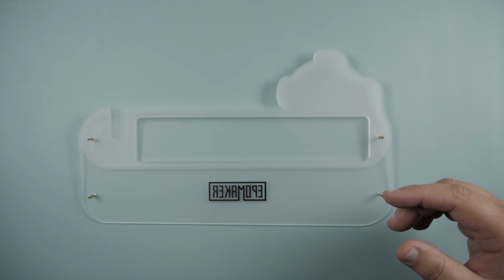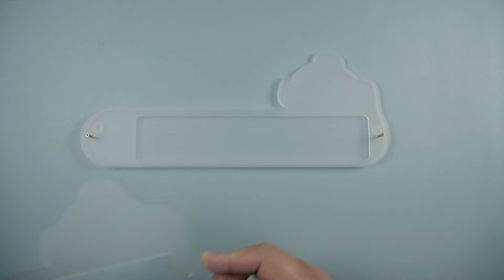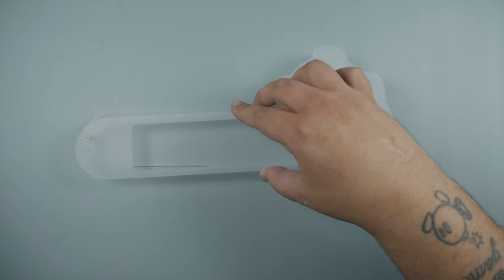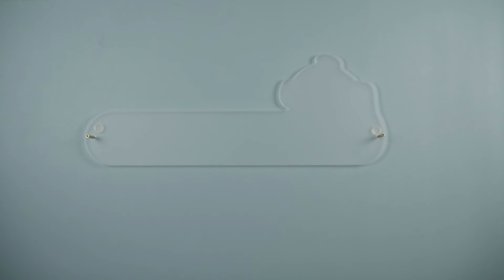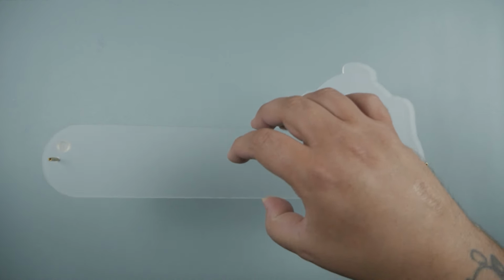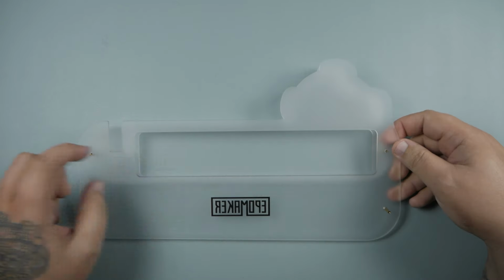Once you remove all that, you'll come to the bottom of the layers. Bottom layers are a bit different than the top layers due to these half size layers. These half size layers provide a nice angled tilt for the keyboard, since it doesn't have any adjustable feet. This will be a better typing angle for people that are using it as their daily keyboards. Now, while we reassemble our layers, I do want to say that I've tape modded our PCB.